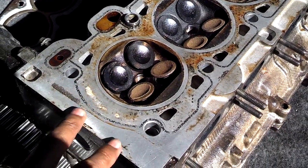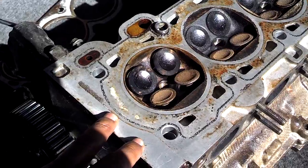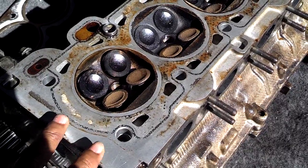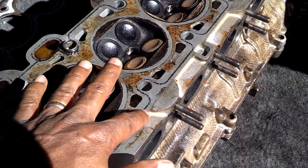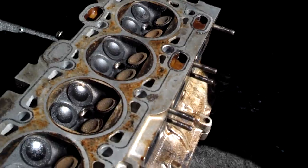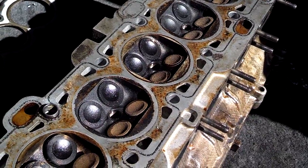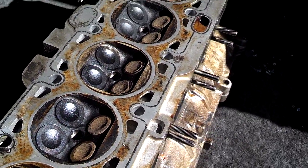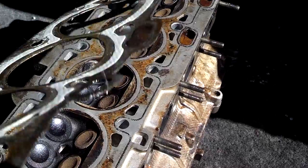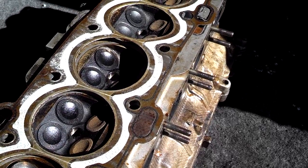You put the chemical on there, let it sit, then scrape it off with plastic. A lot of people use old credit cards to scrape the gasket material off these surfaces so they can be clean and spotless. Once you get all the gasket material removed, wipe it down with acetone — acetone will make it oil-free, nice, clean and dry. Some people like to spray both sides of the gasket with copper coating, but that is not necessary to do with these Volvos.